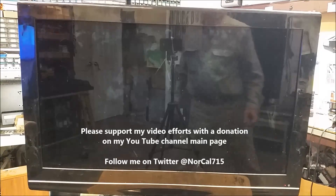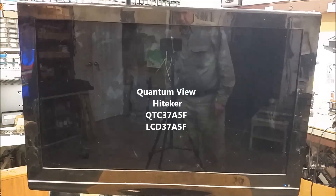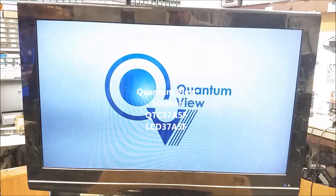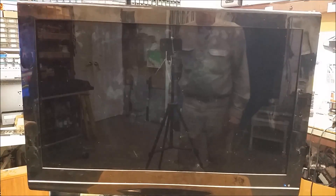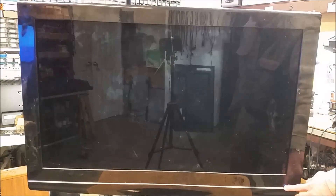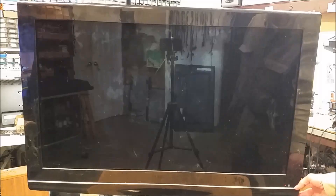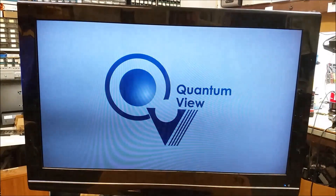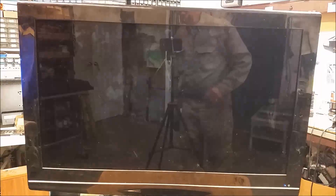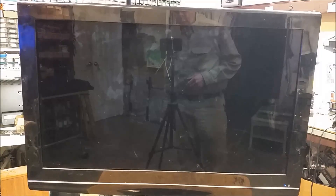So real quick, I thought I'd show you this set. The model is a Quantum View. You can see I just hit the power button — hopefully you can see it down here in the bottom corner. It does light up just ever so briefly, and then the backlight goes out. The power light does stay blue down here. I'm going to go ahead and turn it on one more time. You'll notice that it's a little bit dark right in here, pretty much going straight across. So I thought I'd mention troubleshooting the backlight failure, which is what I believe this is.